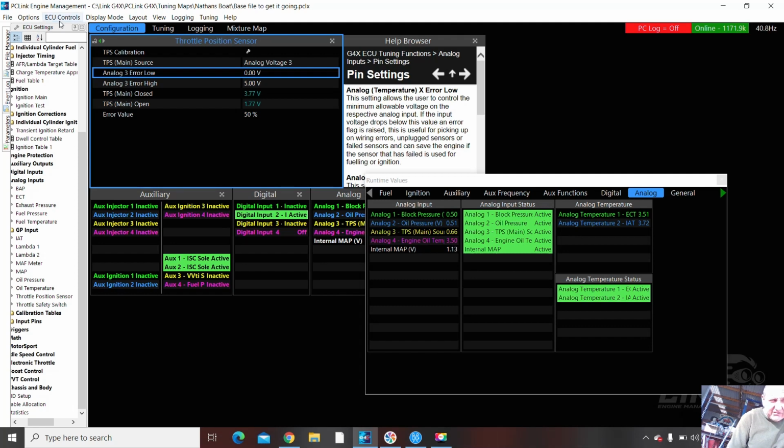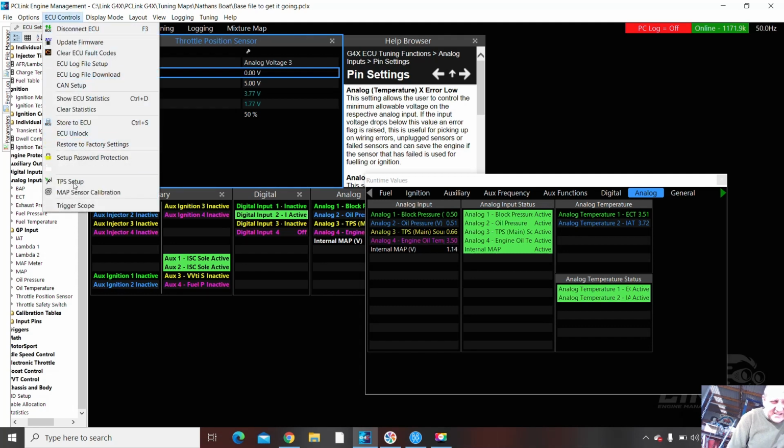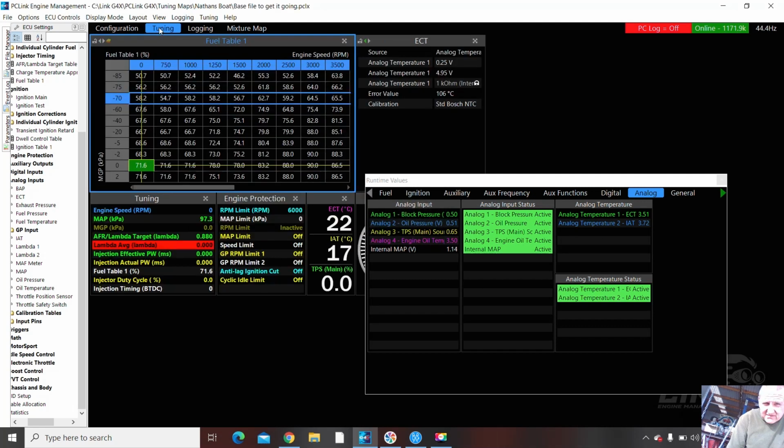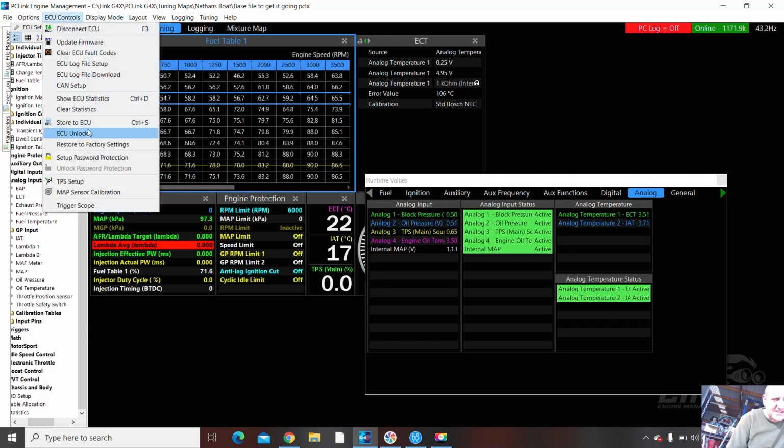Oh, let's do that again. I got it wrong. TPS setup. Bit of practice helps. So it's all the way open. Okay. Closed. Okay. Let's see how it looks. It's at 0. We just span it up. 99.9. Oh. Yeah. I'm happy with that. Store to the ECU.